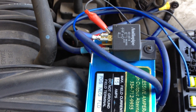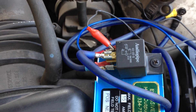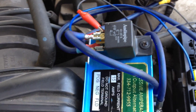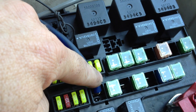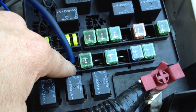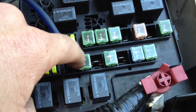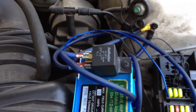You've got number 30 on the relay — this goes to constant 12-volt power. You want constant power. So this one down here on the bottom is your number 30. You follow it down, and what I've done is right here on the fuse box there's a constant power source right here. You can find these with a test light — there's one here and here also. So we've got that positive running to our number 30.